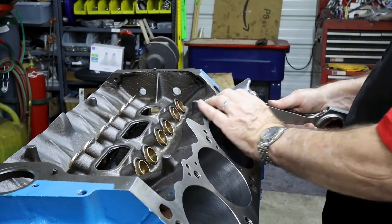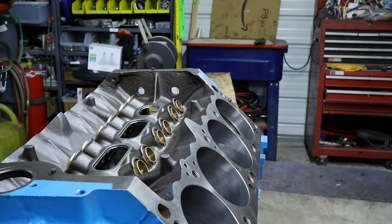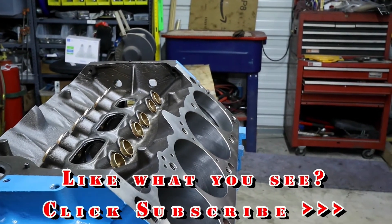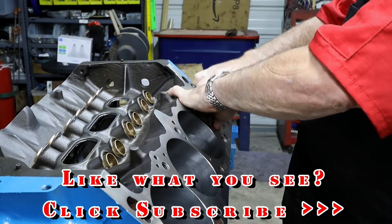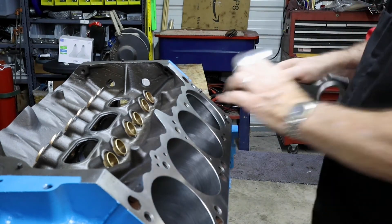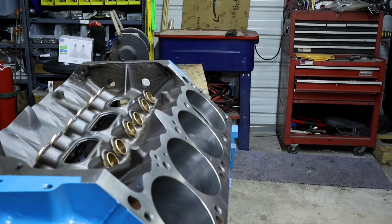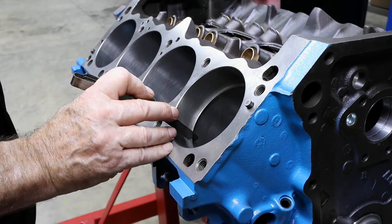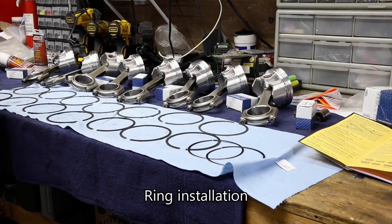Take our piston, slide it down partway through so that both the ring and the piston are evenly set in that bore. Take our feeler gauge and make sure that we're good to go. This process is going to take several times to get right because we're only taking off a little bit at each time — it's easier to cut away metal than it is to add metal. We don't want to be in a spot where we need to add metal, because that means we need to get another ring. Taking our gauge, sliding it in and making sure that it rests flat — it goes in easy. It is time to go ahead and get our rings installed.